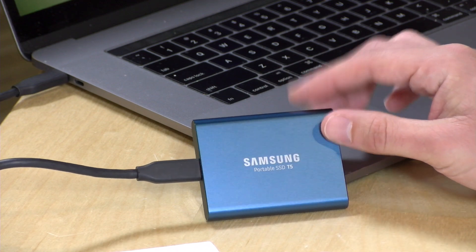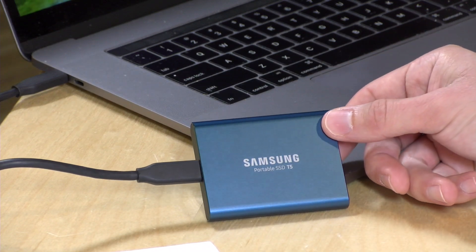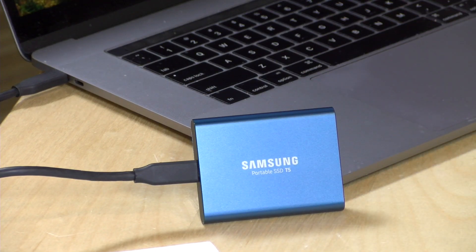This drive has two new features. The first is that it supports USB 3.1 Gen 2, which gives you a maximum of 10 gigabits per second — you'll never quite see those speeds, but it does give you more overhead, which is why we're seeing better read scores in the Blackmagic test. It also has a new form of flash memory called VNAND, which is a vertical flash memory. Instead of making chips that take more horizontal space on the board, they stack everything during the fabrication process, delivering more capacity for less money while keeping the overall form factor small.